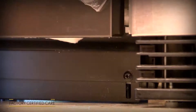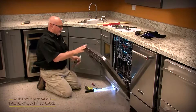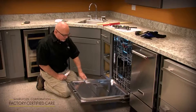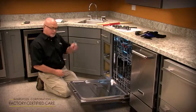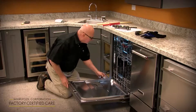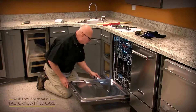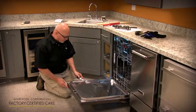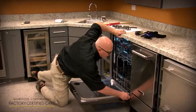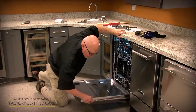The last thing you want to do is remove the protective film from the door. A trick for doing that: if you start to peel it from the edge, you get little shards of plastic that end up on the door and they're not very sightly to the customer. So take your razor knife and score it right against the inner door liner and the door, all the way up on both sides. It makes it a lot easier to remove that film and it looks much better to the customer.